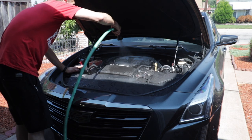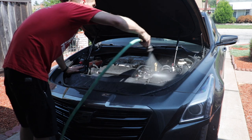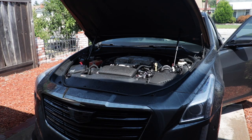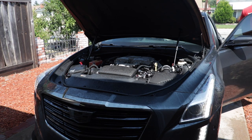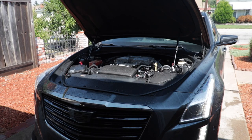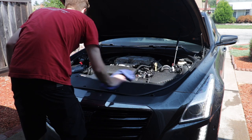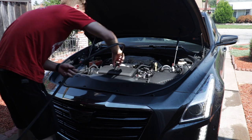I made a mess here because the funnel fell over. It's okay to wash down your engine while it's cool — go ahead and do that, but don't spray directly in the electrical fuse area. Then afterwards, start your car to warm up the engine and evaporate the water, use a towel to assist, and some compressed air will really help get the water out of the crevices.